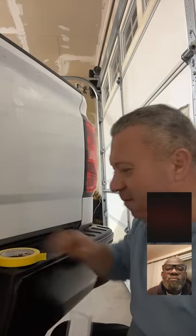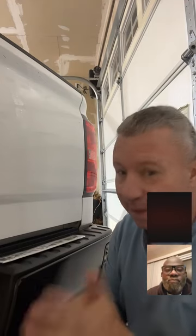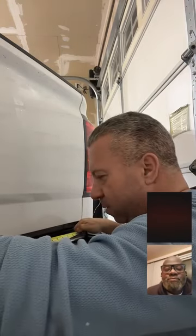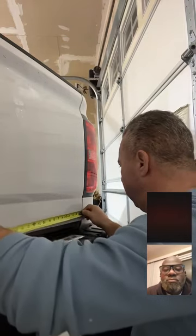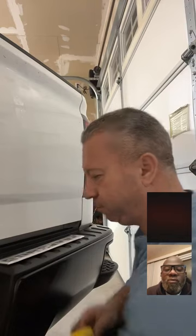And the same principle really goes down to ceramic coatings. Ceramic coating, effectively the clear coat and SiO2, has a carrier solvent in it that keeps it liquid. I want you to put it on the panel and then it evaporates. The biggest thing between flash times is the amount of solvent in the carrier. Yeah, it's in the carrier. So anyway, effectively this thing is a 13 3/4. Refresh My Ride actually came up with a very good point too: ethyl alcohol placed on the panel long enough can affect the clear.